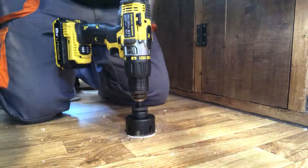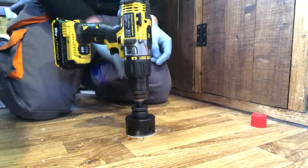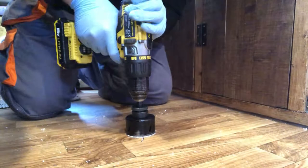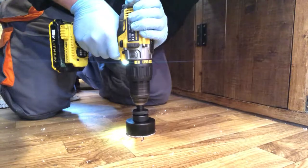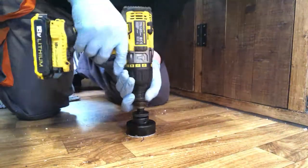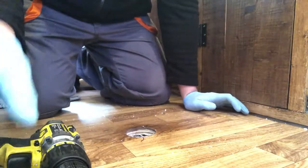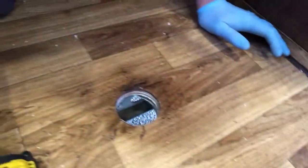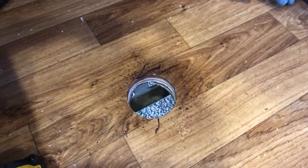The only other thing I add when doing stuff like this is just a bit of WD-40 or some sort of penetrating oil — that is just to keep it nice and cool and also ensure a nice smooth and easy cut. That's all done. As you can see, lovely clean hole there. We'll just get back into shot so we're ready to put some mastic sealant round there and actually fit the plate back into the floor.